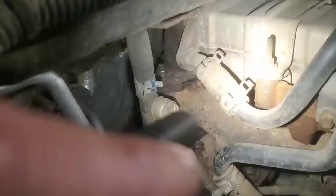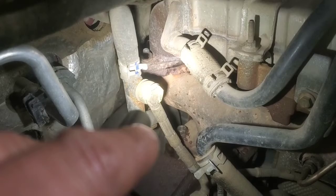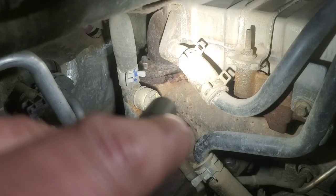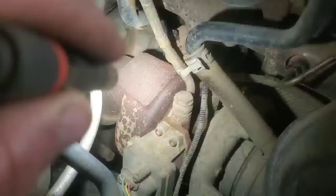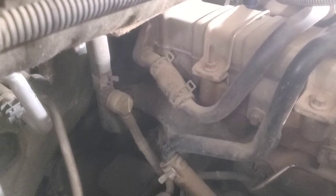This is above the exhaust manifold into this EGR cooler. It seems to me that with just the thing idling, the last one I had in here had a leak back there in the same spot - it was a similar noise, but you could only get it to act up when it was warmed up and driving, turning the exhaust brake on and letting it work. That was the only time. This one making that noise that pronounced just at idle when you turn the exhaust brake on and off is a new one for me. Anyway, we'll get the scanner hooked up and see what we can figure out.